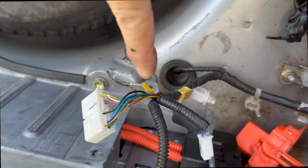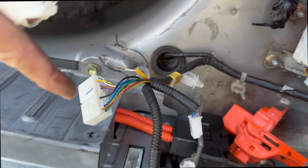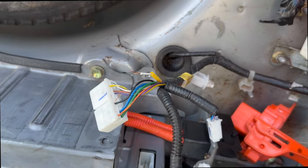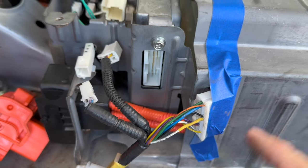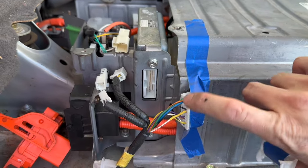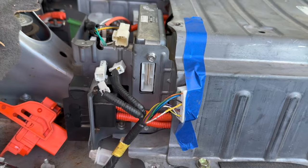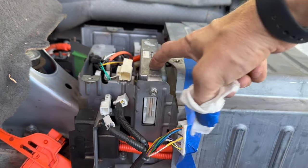To make a good solder joint you've got to prep everything right. I've cut the wires back, got my heat shrink on there already, applied flux, and now I'll solder them together and put the heat shrink over it. Now it's soldered, heat-shrunk, and taped to the case — that's fixed completely. No more janky wire hanging out, and we have a good secure connection to our hybrid ACU.